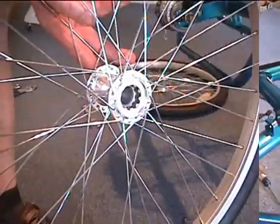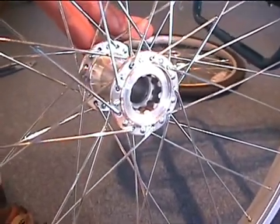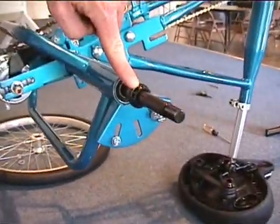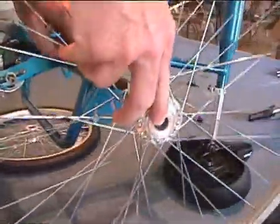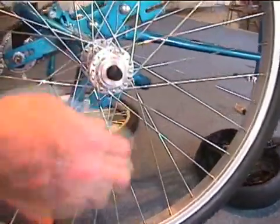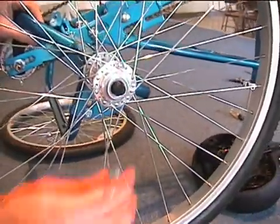Your wheels are the next assembled part. Take careful notice. On the right side of the bike is a splined insert in one of the hubs. It will go on the axle with the splines. The spacer on the end may need to be pressed in and then bolted together.